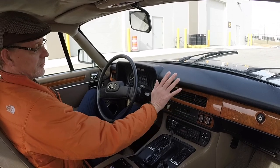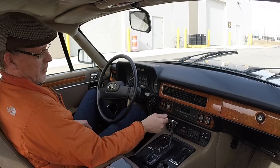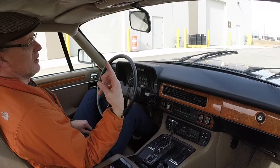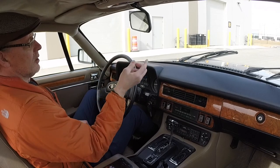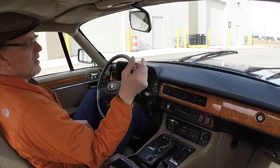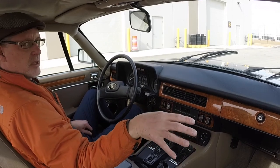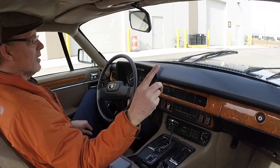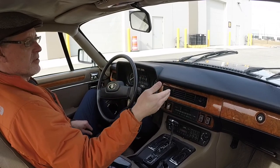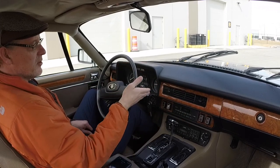Getting cold now. Okay, so the AC in the car does work. That's important because of the way the fuel system works: it sends a lot of fuel around the engine, and then the unused fuel passes through the AC system, gets cooled, and is dumped back into an auxiliary fuel tank. So there's a provision to cool the fuel with its circulation to make sure the fuel doesn't overheat and vaporize.